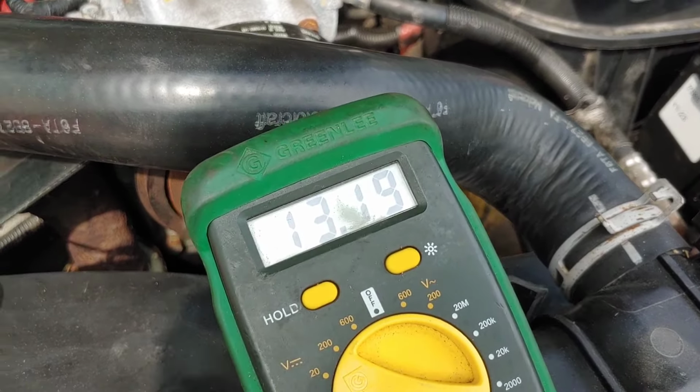No way. Check this out. So this IPR that I was told was new, and then I tried to rebuild it, still had the low pressure. No way. So I just put this new Chinese one in for $50 just to rule that out. Watch this. No way. Huh. So either that IPR really wasn't new or it was new defective. Wow, I'm stunned right now.